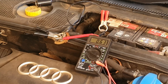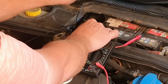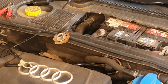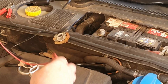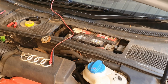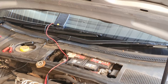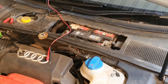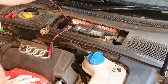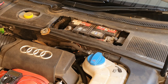So what am I going to do to find out what is still drawing current, and how can we stop that? First I'm going to disconnect my leads and switch off my multimeter. Now, what you can ideally do is open the fuse box — in this case it's inside the vehicle. In many cases you can simply leave the leads connected and place the multimeter face-in on the vehicle windscreen like that, so you can see it inside the vehicle and keep an eye on the readings while you're working at the fuse box.